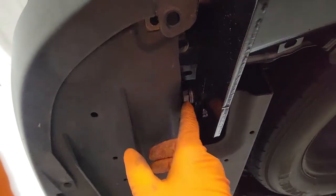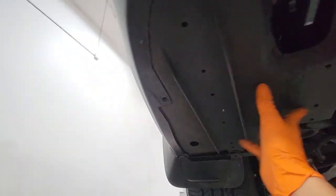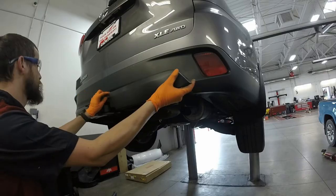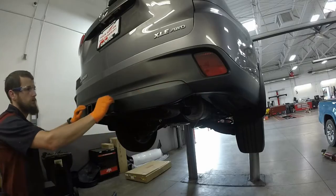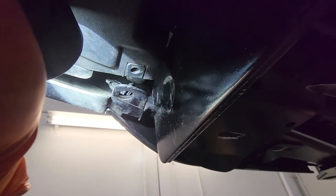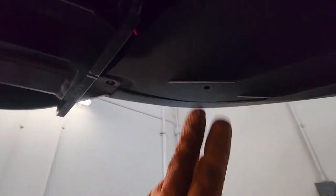Here's what those pieces look like when they're installed. It makes a pretty clean loop around the hitch, so everything is nice and tidy. One thing I forgot — this bezel has a hidden clip that you need to install. It goes right there, so it'd probably be easier to clip that in before installing these pieces. I was able to fit my fingers up through there and clip it in. There's one on this side too — make sure you get those clipped in and then you can bolt the side shield back up.